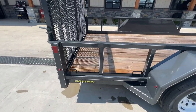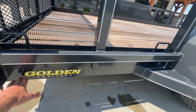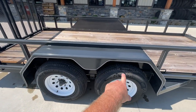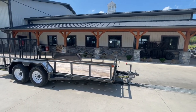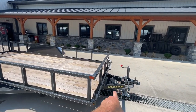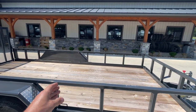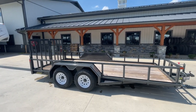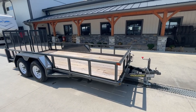One thing that's also not typical in the industry would be — where your golden sticker is — typically you just have your angle iron frame, but this actually has an under-frame bridge underneath it behind the axles, which is nice. Your wiring in your fender boxes is concealed in conduit. So again, nice heavy-duty design. I've pointed out a good maybe 12 features: chain tray, Demco coupler, spare mount, lots of tie-downs, rub rail setup with tube uprights and top rail, drop axles, a better grade of lumber, higher sides, lower deck height, heavier fenders and tread plate, gussets. There's a lot going on in this trailer that make it a more commercial duty cycle type of unit. This is available in different lengths.